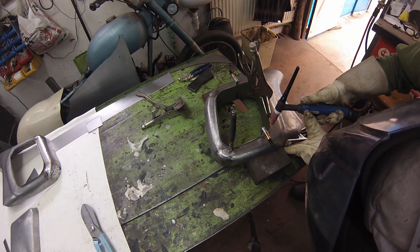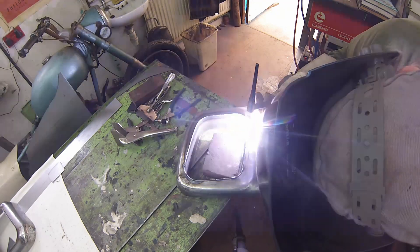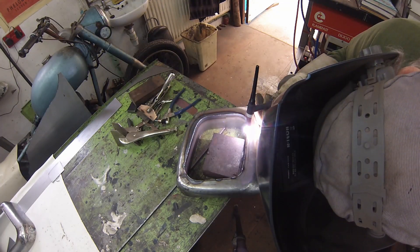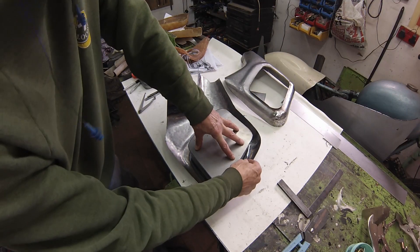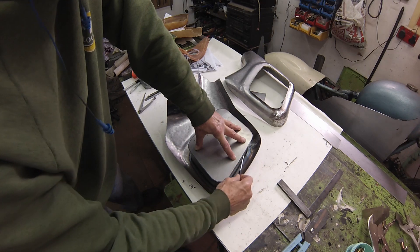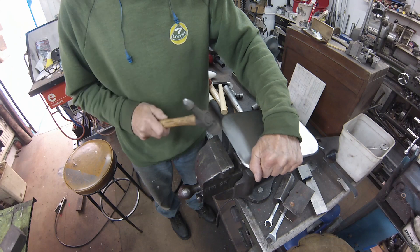Well, obviously I didn't mean pull that hard! Here the slightly twisted front panel's arrangement is reset by welding in square cropped sides. The left-hand tool box also has a cutaway to clear the chain guard, but it's simpler to complete a handed pair and cut and weld the reversed section later.